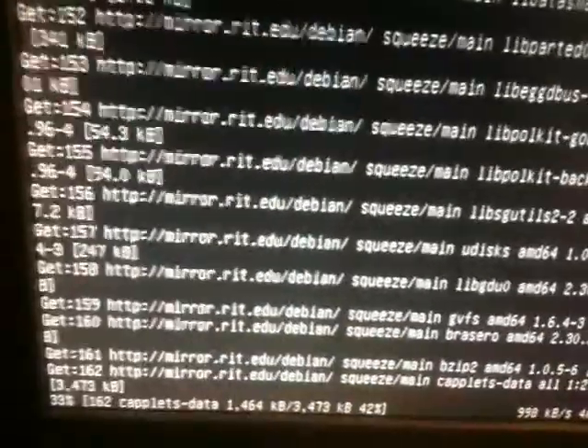Alright, so I ended up playing around with that nettop. I've got Debian installing on it right now. It's going to become the main hub for my game servers and the TeamSpeak server, among other things. The main thing is I left the hard drive the same — that 80-gigabyte Hitachi. I stuck four gigs of A-Data Blue DDR2-800 5-5-5-18 RAM in there. I put the mixed three gigabytes into the ES2L board, which is now running Arch Linux, so I don't have to worry about the RAM as much.